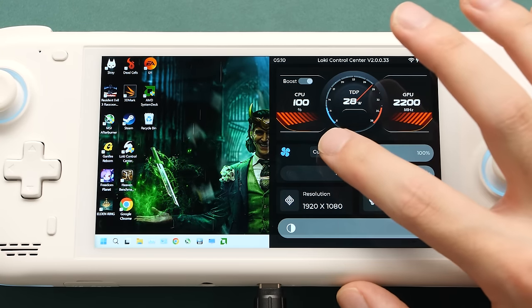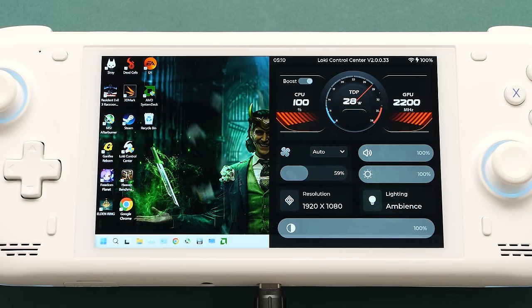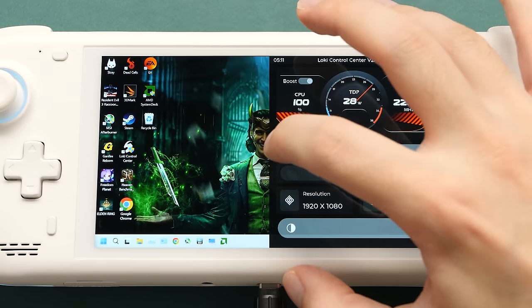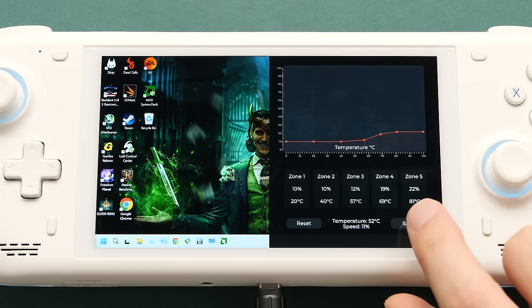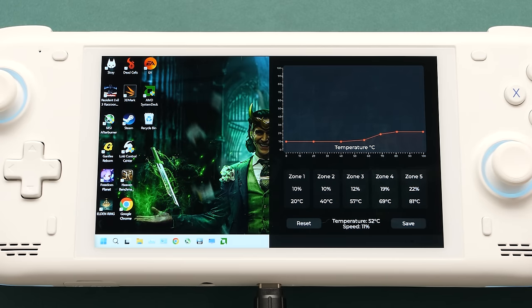Down from here, there's a fan icon. I have this set to custom right now — if we go back to auto, it ramps up quite high. The fan curve on this is kind of crap, and to be fair it's kind of crap on a lot of devices. I think the Steam Deck and the Ally are the only devices with good default fan curves. This one is really aggressive — right now it's at 69% fan speed and I'm doing nothing. You have a manual setting that lets you go down to 30%, which can get you by up to around 15W TDP, but 30% is kind of high for idling or low TDP. I use the custom option, which drops the fan down significantly. I'm kind of going for an ROG Ally approach where you just don't let the device make noise at all — around 10% fan speed, ramping up at 60°C, and maxed out at 22% at 81°C.